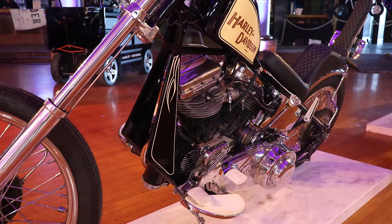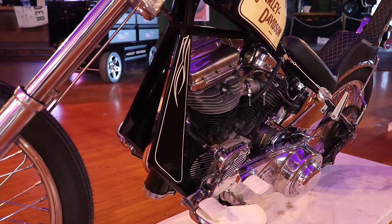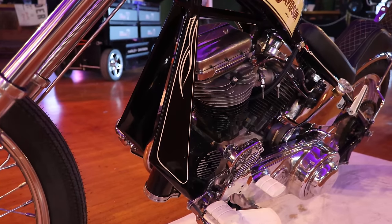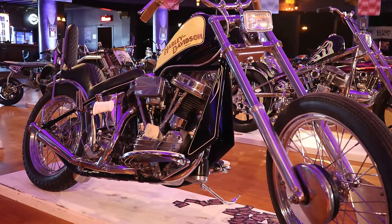It's a little bit of both, and you learn things as you go. For example, when I used to make seat pans, we used to make them too short on the back. And some people like that, that's a look. But I've learned that for a king queen seat, if you give it a nice big-ish hump, then you get enough room and support in your back. So it's a little bit of trying to make it fit your body. But you have to have a vision in mind first of what you're going to do.